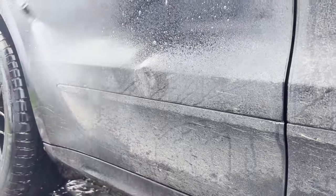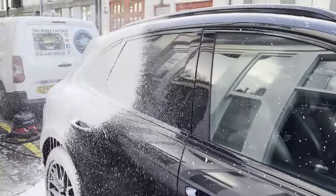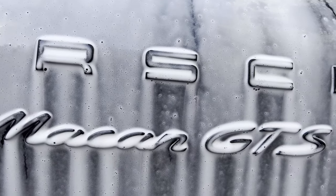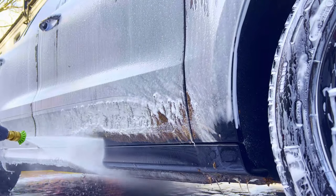What you do is spray on the dirt remover to the lower portions of the car, and then cover the car in snow foam, leaving this to dwell for a few minutes before moving on to the next step of the wash, which is the pressure wash.